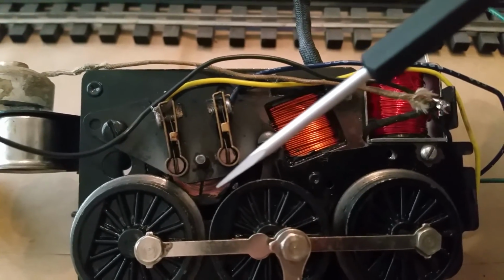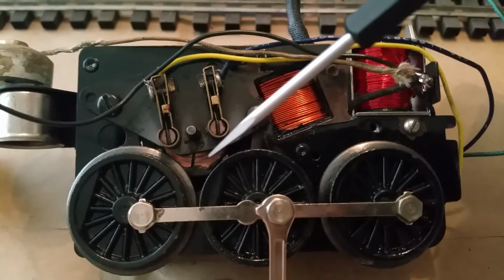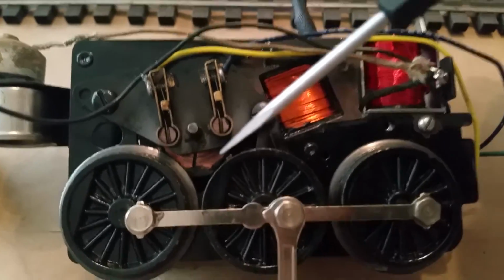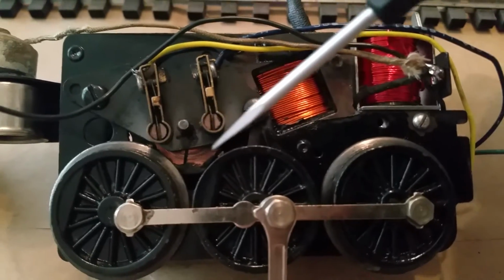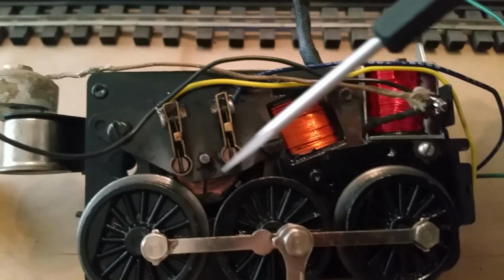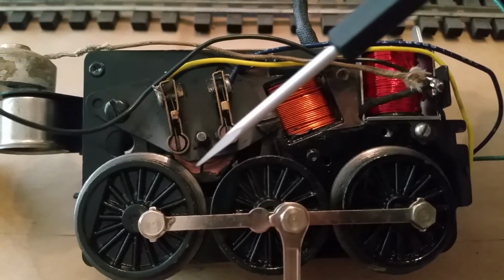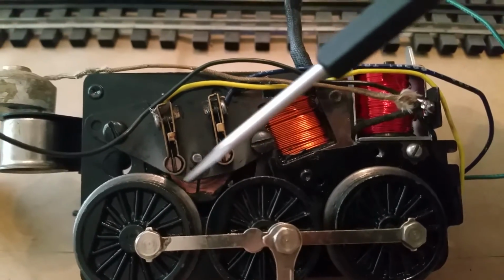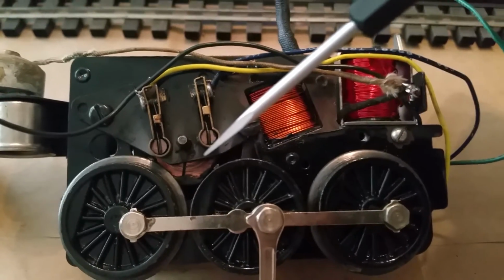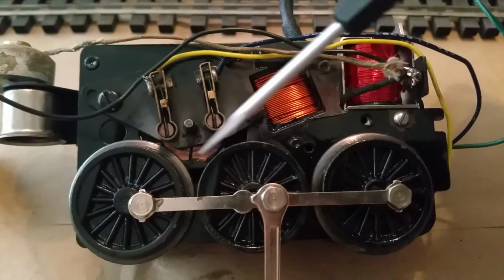What you want to do is use electrical cleaner and degreaser, take a cloth or a rag and clean this off. Then use an eraser head, and it pulls the existing carbon off of the plate and it looks brand new. You will not damage this at all.